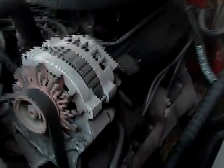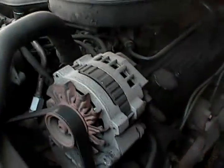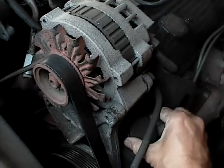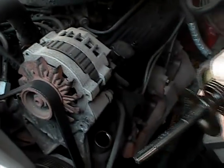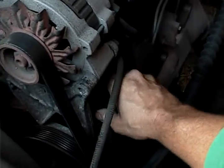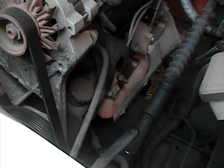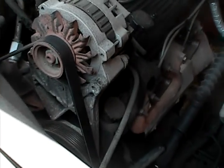Some things to check: you've got a power steering pump. Not all cars are exactly the same but they're similar. You can check it with the engine off or on — just be careful that you don't get in the way of the belt. This one is actually low, so it needs power steering fluid. The power steering pump takes transmission fluid, which is the same thing as power steering fluid. Some cars, though, actually use hydraulic fluid in the power steering pump — that is usually in high-end foreign cars like BMW.